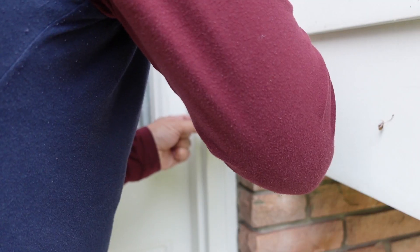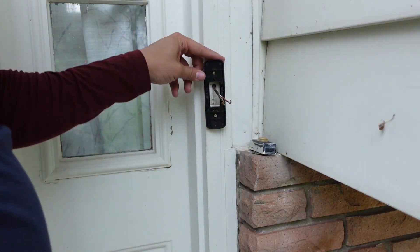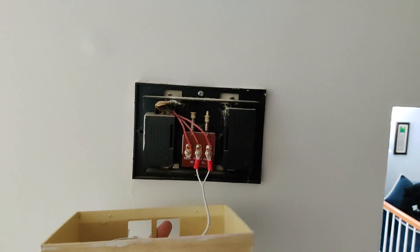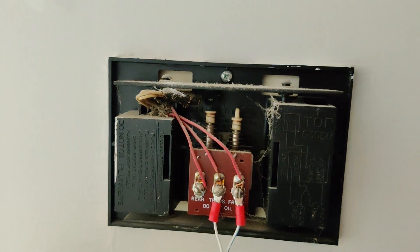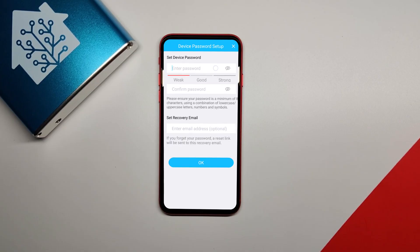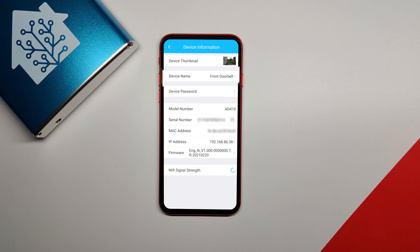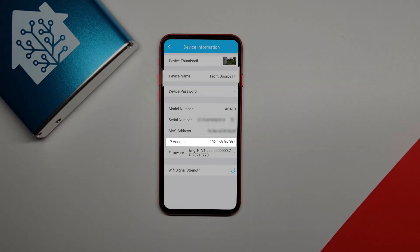Installing this doorbell is super easy. A mounting bracket and some plastic wedges are provided to give you a solid mount as well as a good angle for the doorbell camera. As part of the chime kit there are two wires that need to be added to your existing doorbell chime. After that the two wires that connected to your old doorbell will connect to the back of this new doorbell. Follow the steps in the app for setting up the device. One of the steps requires you to set up a password — remember this password because we're going to need it in Home Assistant. Once your device is set up in the app, tap on the device and then tap the settings gear in the corner. Then tap device information and here you'll find the device IP address. You're going to need this IP address for the Home Assistant integration, so write it down. I also recommend setting this as a static IP address on your router so it doesn't get changed on you.